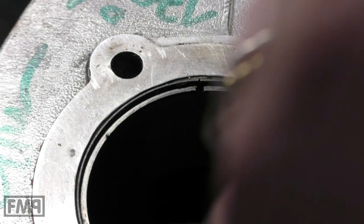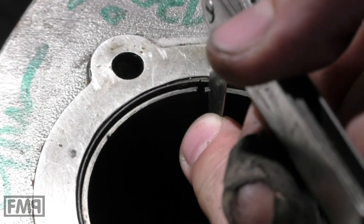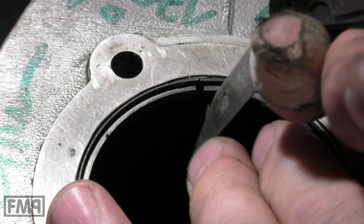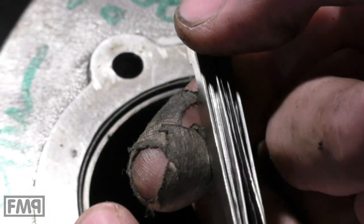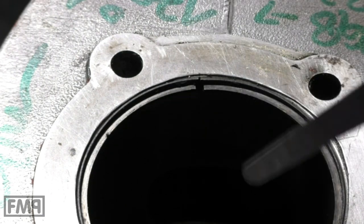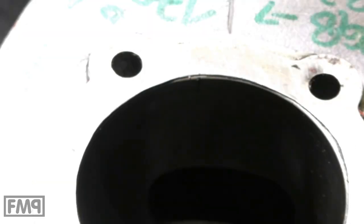0.4... that's close on 0.5 — and 0.5 does fit. So this ring has 0.5 millimeters gap. That's the top ring.